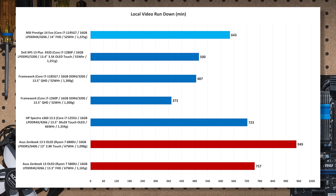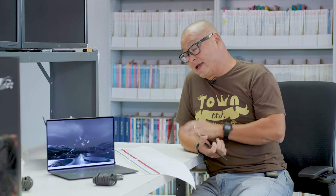The Spectre has a bigger battery which generally helps. Spectacularly good would be the ASUS Zenbook 13s OLED pushing 16 hours of runtime — yes, it has a great big 67Wh battery versus the tiny 55Wh battery in this XPS. Far worse would be the Framework with the 1260P and a similar 52Wh battery, at only six hours — that's just not fantastic. Alder Lake overall has not impressed me with runtime, but it's okay. The XPS does have a 3.5K OLED which could potentially use more power than a lower-resolution panel.